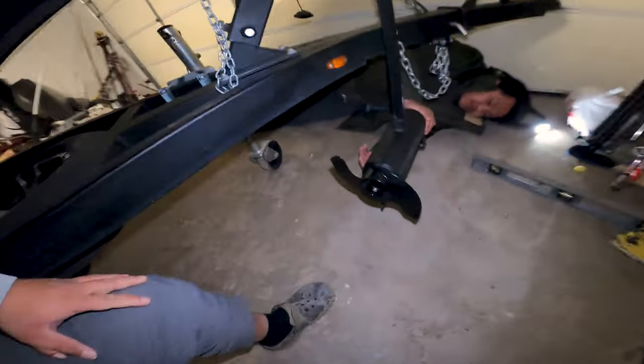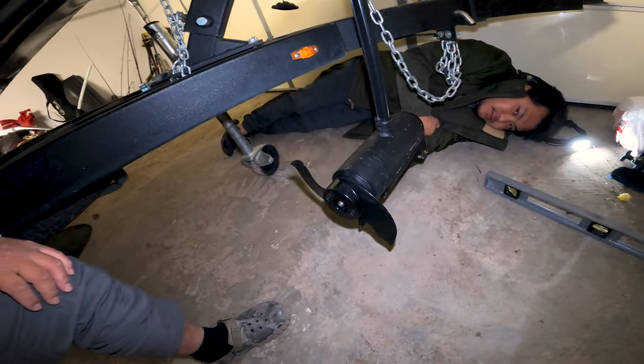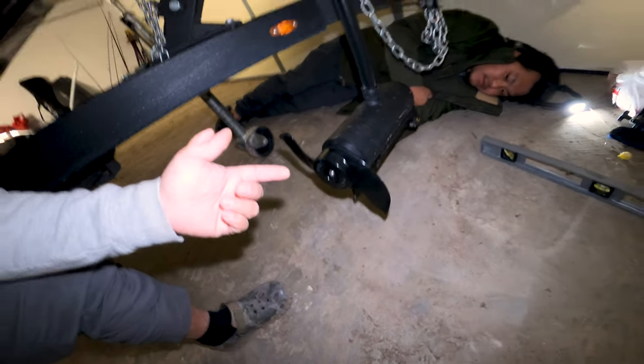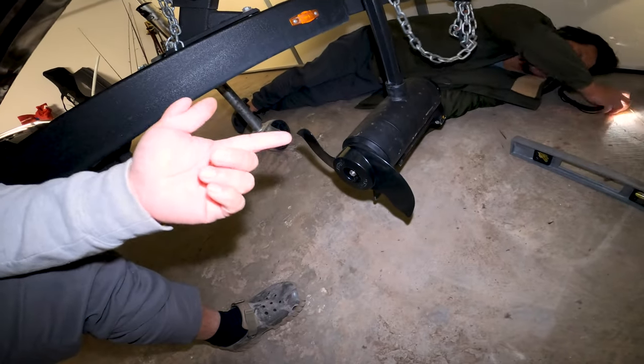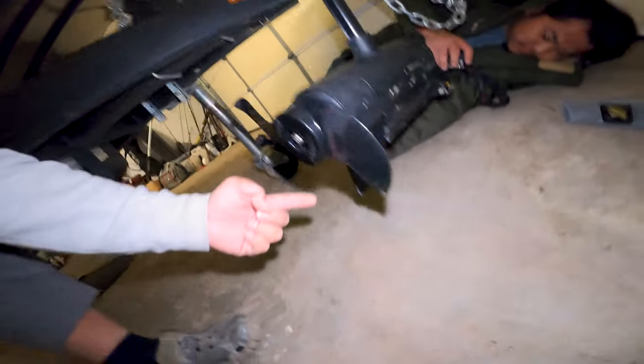I'm pretty excited about it. Yeah, that's pretty much it. That's how you change a prop. That's how you tune a motor. That's how you adjust the ultrasonic sonar. And that's how you fix the skeg. That's basically everything you need to know about how to service a trolling motor without replacing any parts.